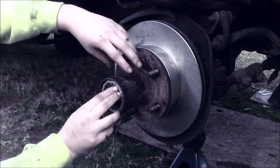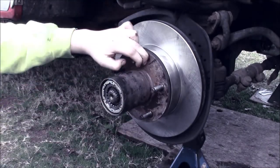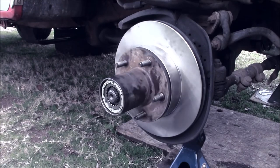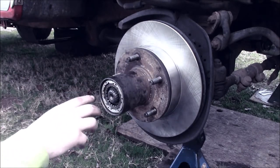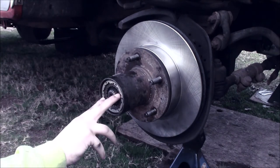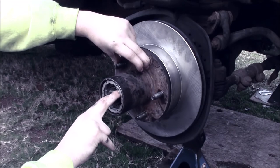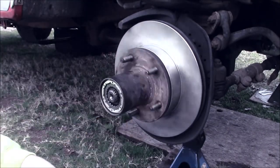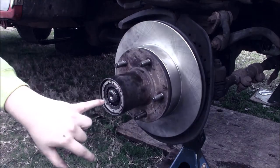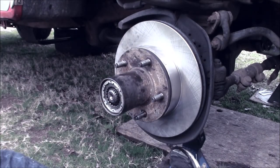And see, the way this works, it goes in there and catches that. See, now, four drives engaged, four drives disengaged. So basically it catches that. This is your four-wheel drive shaft. Once it catches this, which it has to turn like that, now it spins with it. But now it spins freely. So if that is constantly engaged, your four-wheel drive will always be engaged with the hubs.